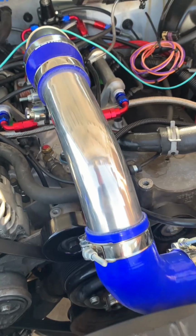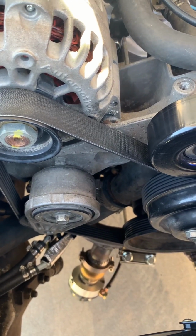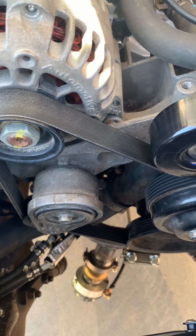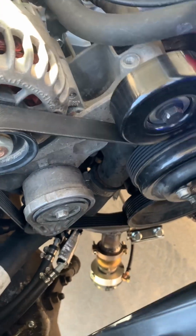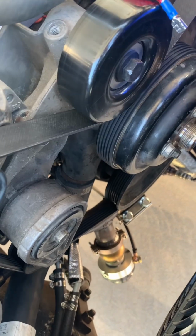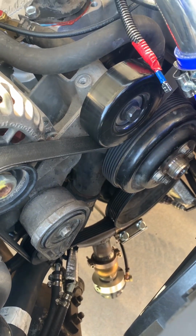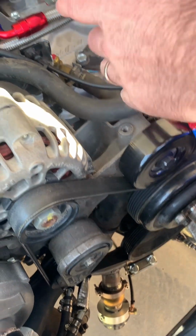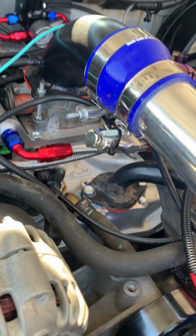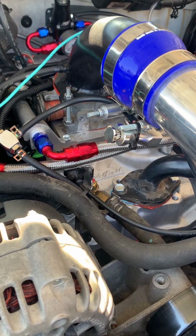Okay. You hear those turbos flutter. That's because they're not running a blow-off valve. Supposedly that's hard on your turbo. That's the wastegate down there. Mm-hmm. And that's a 38mm wastegate. It's got a 10-pound spring in it. And then I run this little inline boost controller right here. Okay. And I've got her turned up to 14 pounds right now of boost.